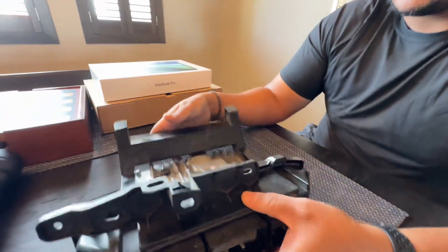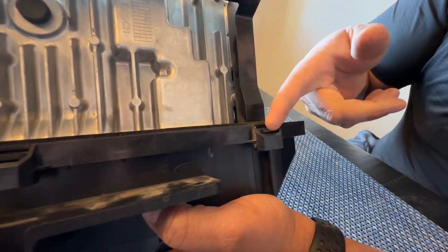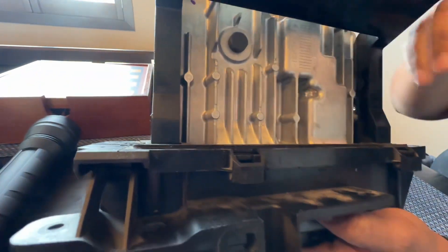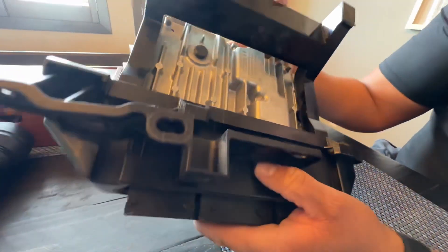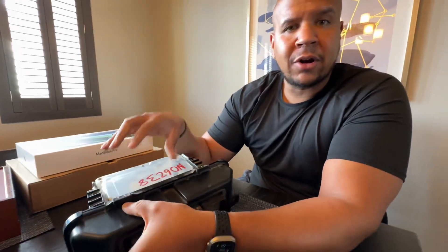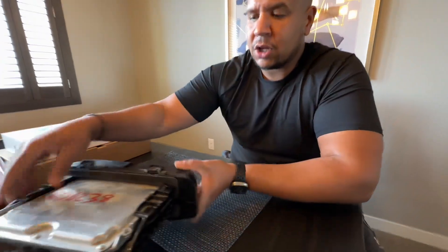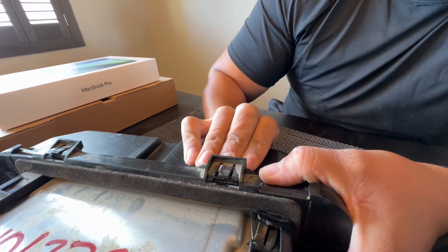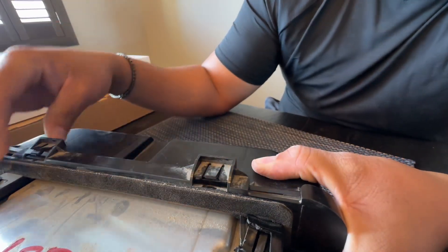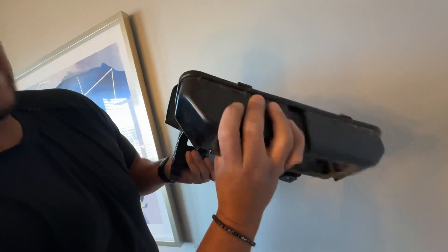You have these that are going to need to come up — click up, click up — and then you're going to be able to slide the ECU out. So when I tell you guys in my instructions to squeeze it like a hamburger, you really do, because you need to see this clip here come down. Once it gets dislodged, it can come out. So when you push down and squeeze like a hamburger, it's able to come out.